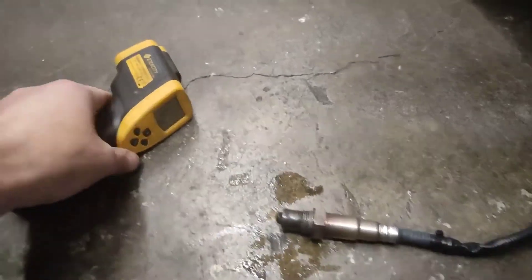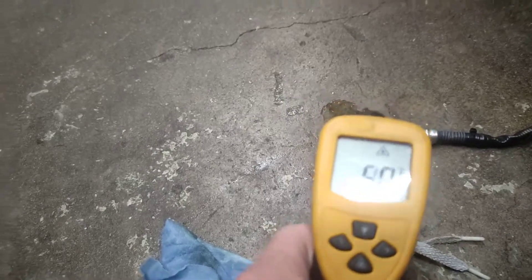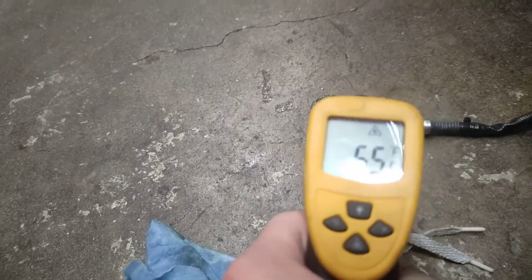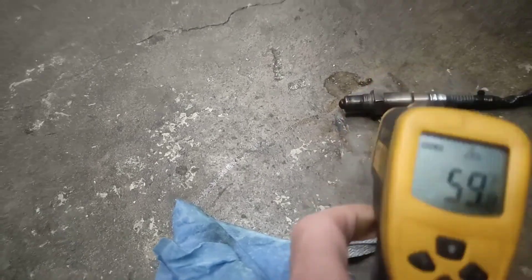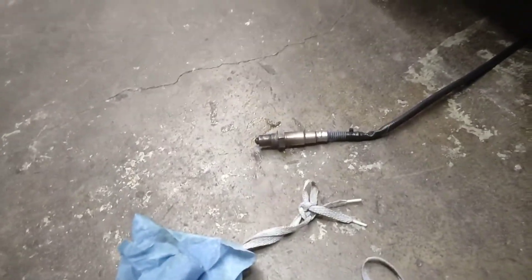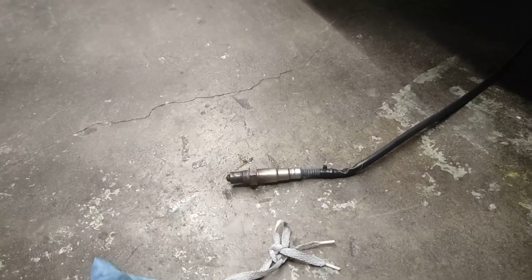And the sensor is not heating up — 70 degrees. I think these things should be heating up to 150 or 200 degrees or so. It's reading 59 to 60 degrees, so I think there's definitely an issue with the gauge. Anyway, we'll work with AEM on getting a warranty replacement and go from there. Thanks guys.